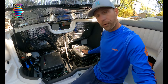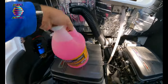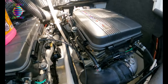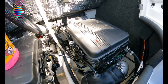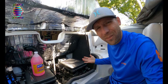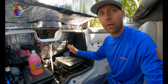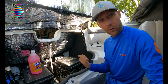We're in my boat — this is an '08 AR 230. People that like to use the good old pink stuff say it gives them peace of mind and that it lubricates. But there is nothing to lubricate — there are no pieces to lubricate in this boat. Your motor does not have a water pump. People wonder how water can circulate through the motor. Well, that is done by your impeller.